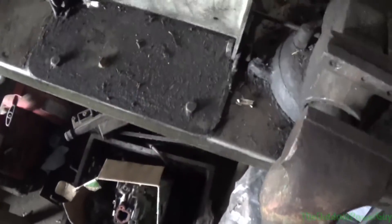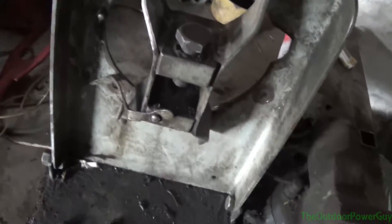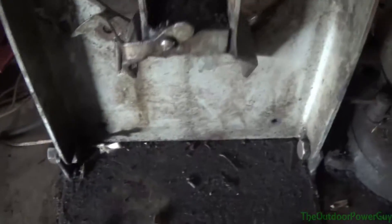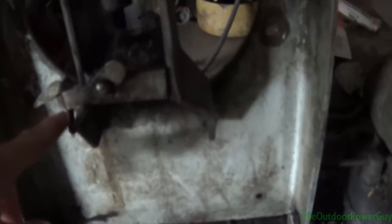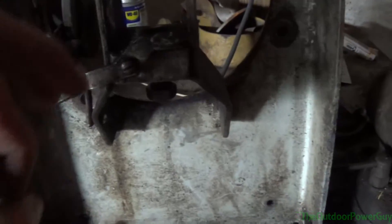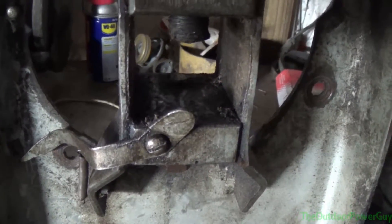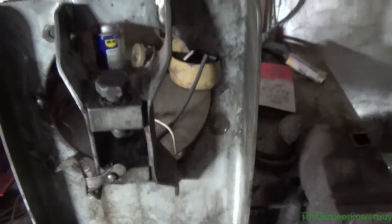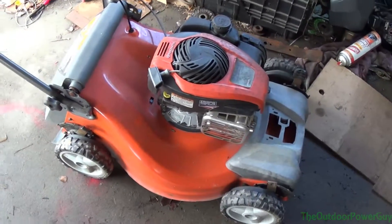Here's what the machine looks like with the motor off of it. This is bolted to the table - it's very old, older than I am, and I'll be 23 in 2019, so this thing is probably 25-30 years old. It's designed for push mowers because push mowers is what you'll have bent crankshafts on. The shaft comes through here and they make a sleeve that slides over it. You tighten this big machine screw and that exerts a downward force on the high end of the crankshaft where it's bent, and that straightens it.